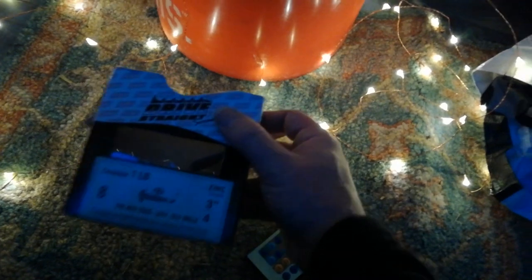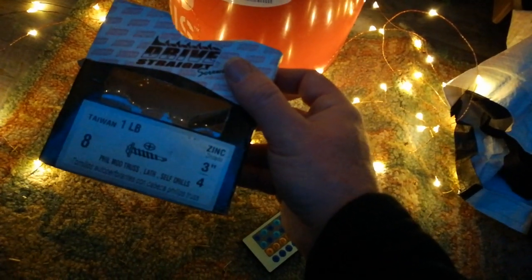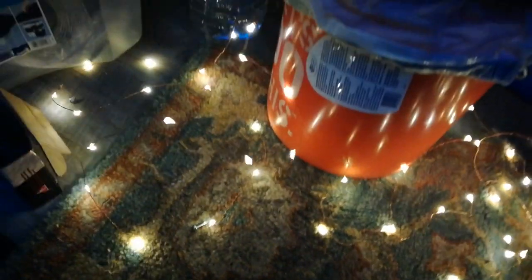Here are the type of screws that I'm using. Zinc, 3/4-inch. Anyway, self-tapping, that's the secret. Just make sure you don't drill through the skin of your van. Also, these work pretty well. These are automotive upholstery screws. They're not really screws. Well, here's what they look like. Just clear, and you can find them at Walmart.